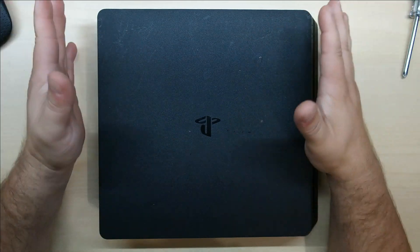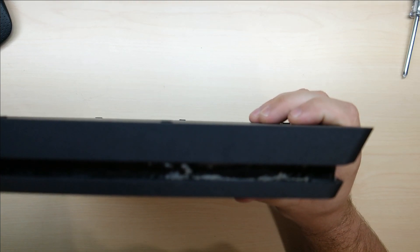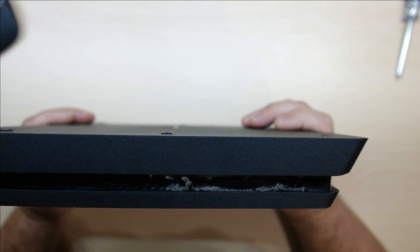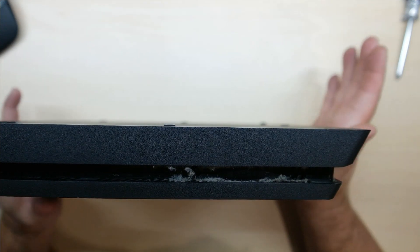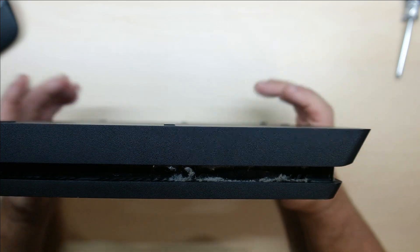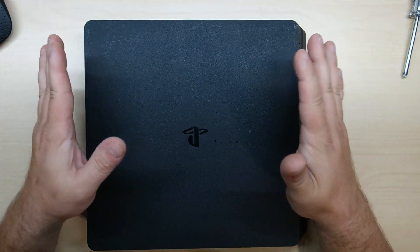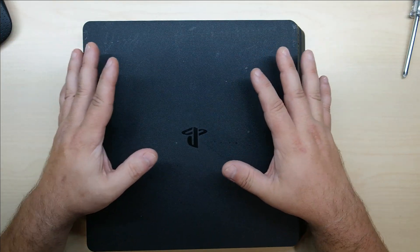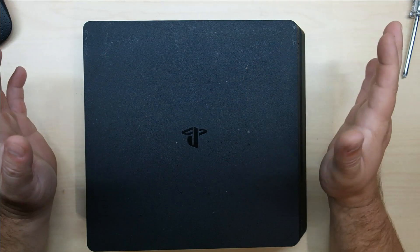There really isn't much to it, but here's the first sign — look at all of that dust that's built up in there. The funny thing is I've been to my co-worker's house — his family is not dirty; their house is even cleaner than mine. But this was always sitting on the floor. Even with a clean house, you never put electronics, a console, a computer — anything with a fan sucking stuff in — on the floor, because it will inevitably get clogged.